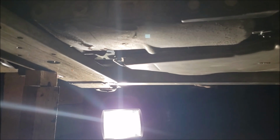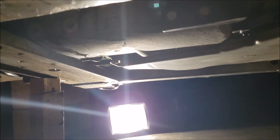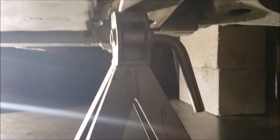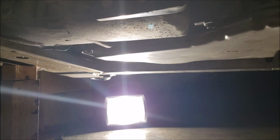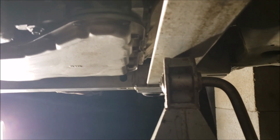You know, I went ahead and just kind of cleaned everything. You know, 289, my motor's always been clean. This leaking mess, I wasn't going to have it. So then I take a jack stand, okay? And depending on the size of your jack stands, you want to be able to get at least halfway, okay? See how this one's loose? Depending on where I'm working, now I got my safety crutch. So if that board, if I kick it out, which, you know, it's got the motor weight on there, you'd have to hit it pretty hard. If I bump into it, kick it out, this is going to catch it. When I'm working over on that side, I mean, I can move it around.